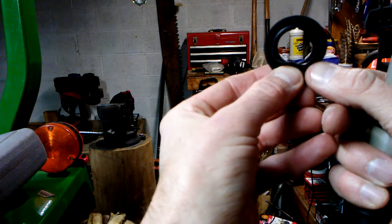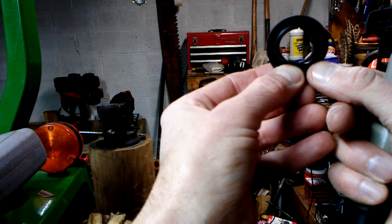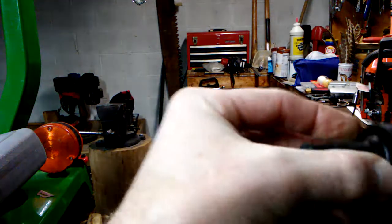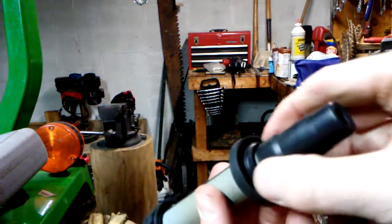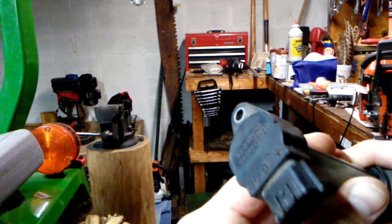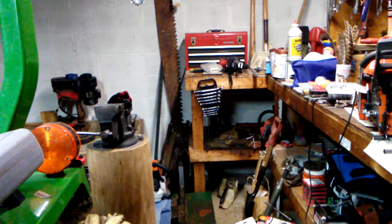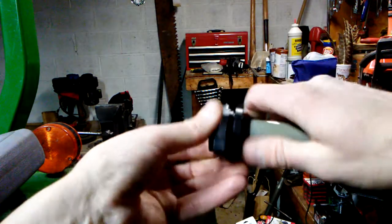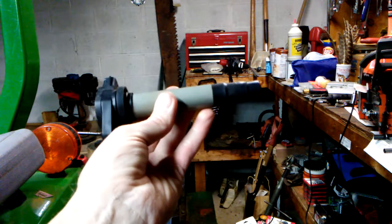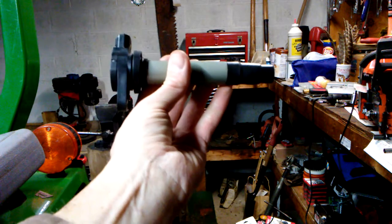If you'll notice in the top of that o-ring, you'll see the groove that rides over that retainer spring, so you want to line that up. If you've got this not aligned properly, that could be a source of oil leaks. Taking care to make sure that groove is aligned properly. There we go — and obviously it goes into the car. They did a separate video, but that's the installation of the boot seal kit. Thank you for watching.